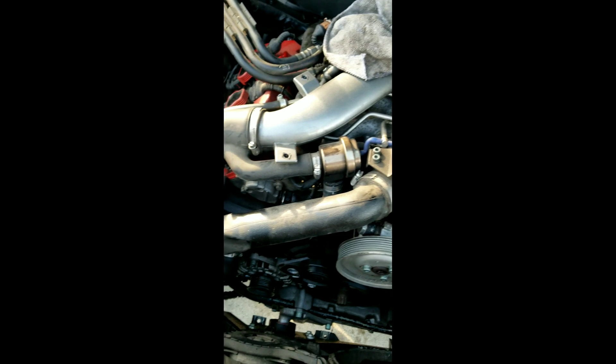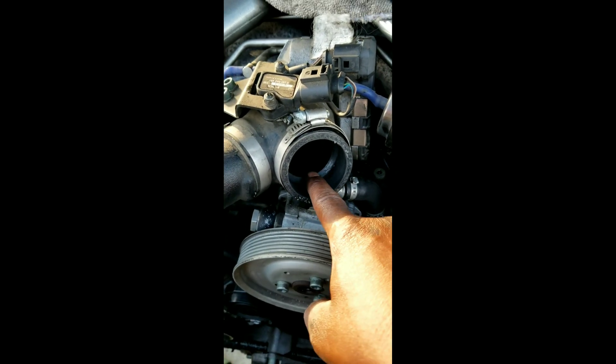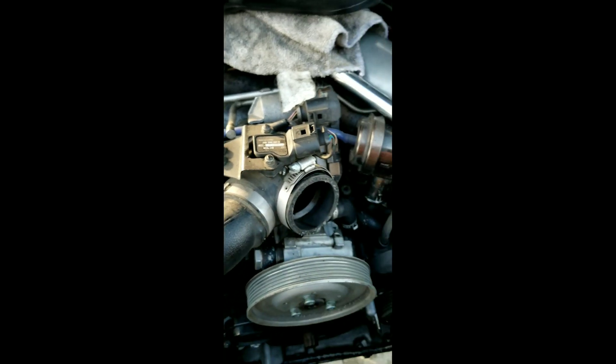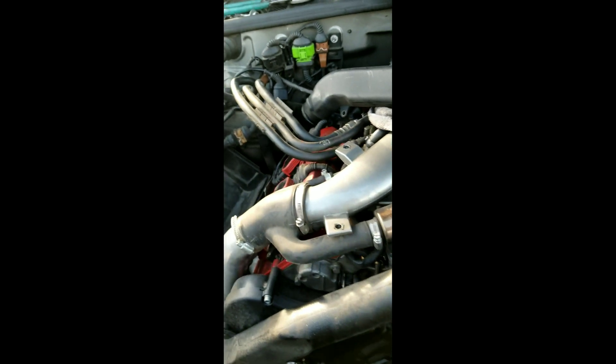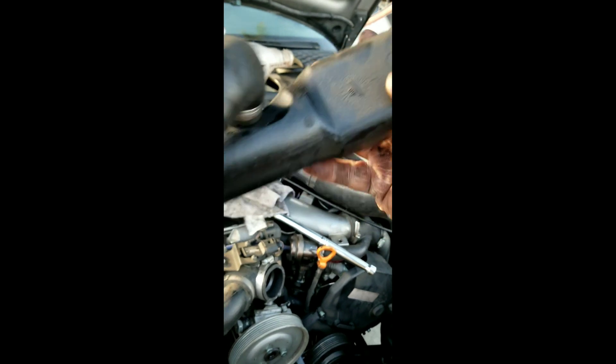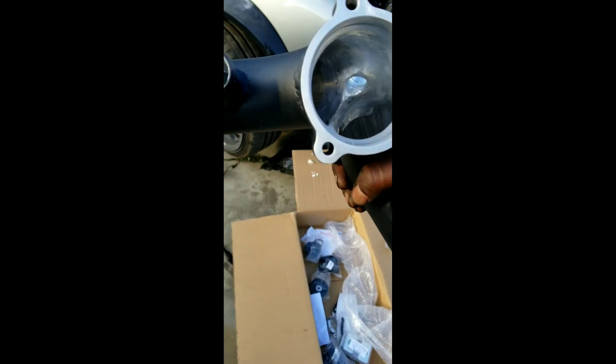The other thing is the XS Power bipipe. These are the old ones — they just go on the motor, there are two of them, and there's a boot. The stock one always goes bad and tears, so I upgraded to a silicone one — the 034 one, which is a really good one. It has a locator ring built in to connect it to the throttle body. But you can see right there that little step, which could be a restriction. This one has a bump and then it turns square, but the XS Power one is tubular so there are no restrictions in it.